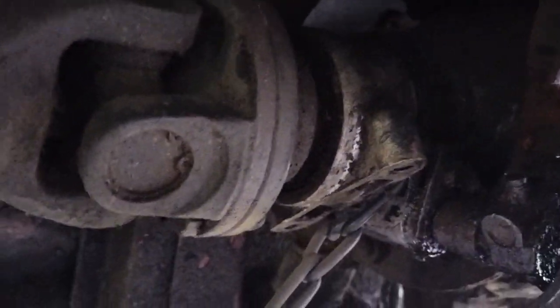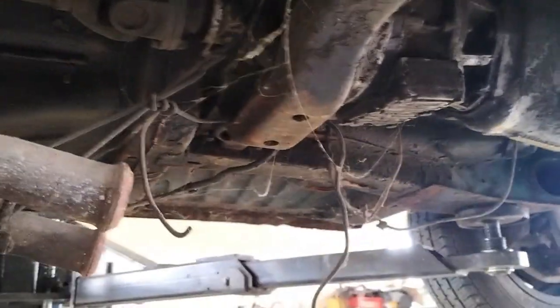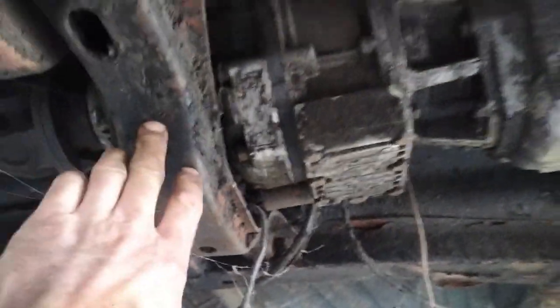It's a manual prop, which means it has a flange on each end with a set of 9/16 UNF bolts through it. Super high tensile. Always keep those with the prop because they're the correct ones. So unless they're damaged, they're always good to go back in. Cleaned, obviously. Then I'll be removing the gearbox crossmember here.